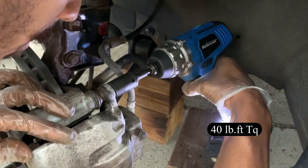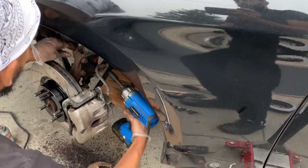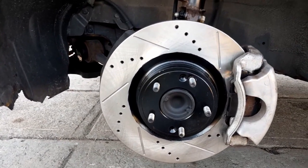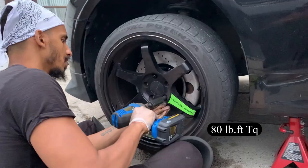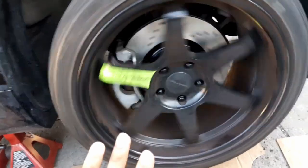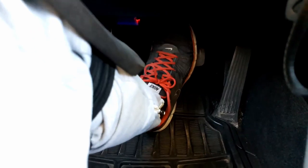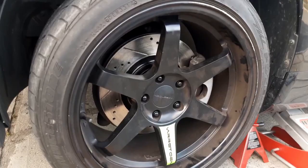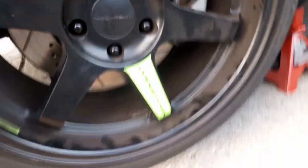I used an impact driver just to screw it on. And that's what the final brake job looks like with the rotor on and everything else. Alright, the wheel is on. We're gonna spin it — no sound, very good. Now before you even drop your car, you gotta step on your brakes a couple of times to build pressure. So now we can lower this car. And that's how you change your brakes and rotors. Hopefully you guys like this tutorial — make sure you like, comment, and subscribe. I'll see you next time. Peace!